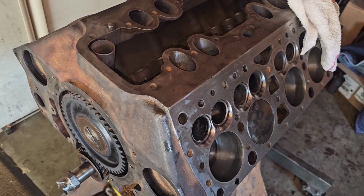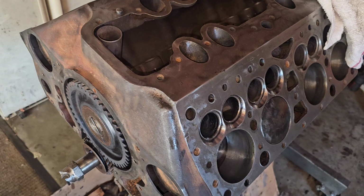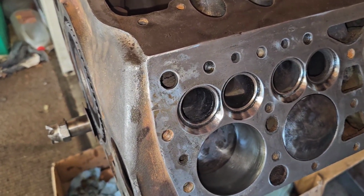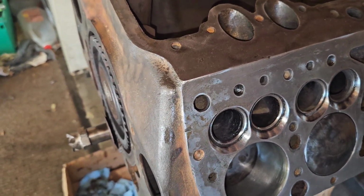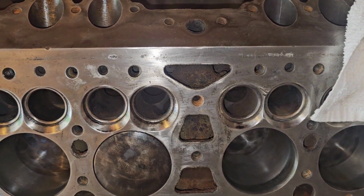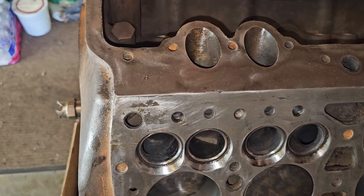So, this engine ran good before, and now it's just a little freshened up with rings, bearings, whatnot, everything checked out and spec'd. And these cylinders didn't clean up as well as what I wanted them to, but there was literally no ridge at all in these cylinders when I honed them. They weren't really egg shaped or hourglass shaped. Everything was in pretty good shape, so I'm actually super confident about how this is going to work out. So anyway, I think next video we'll get the front end of the engine together, maybe even get the intake on it. That would be cool. We'll see if we get that far or not.